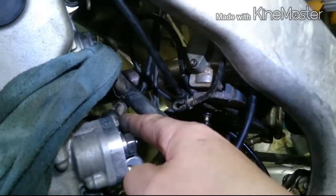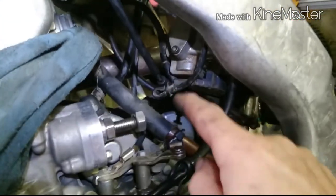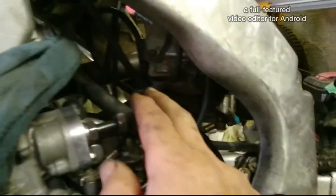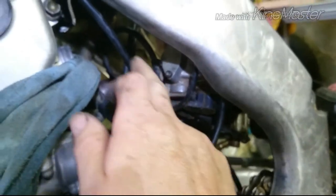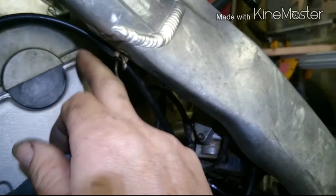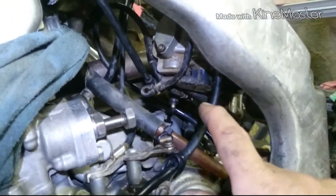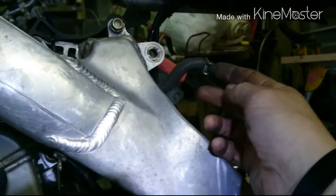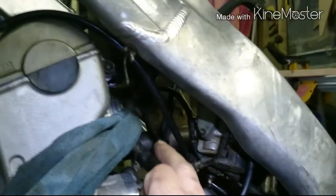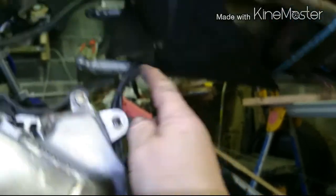it's going on top of the, was that the starter motor wire? It's on top of that, and that's your hot start going up there. That's the start of that, anyway. It's going up there on top of the crankcase cover. And what else do I need to remind myself? Well, that's the back. That's a T piece coming off the crankcase breather tube, going to the airbox, so that will eventually go into that when I drop the back end down again.